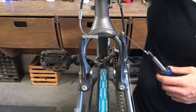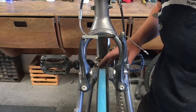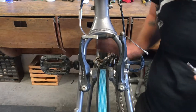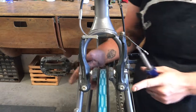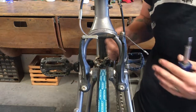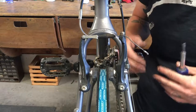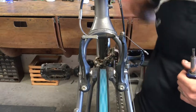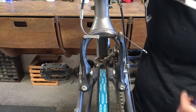That's looking way better — possibly even a little too much. Spin. No rub. I'm going to put a tire on first, go out and do a hard test ride, and make sure that my adjustment stayed. If it doesn't, just add little increments to either side, test ride, and double check your work. Once there's no rub and the pads are hitting at the same time on the rim in the same place, you're good to go.